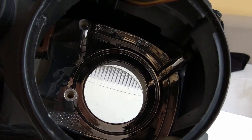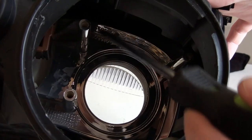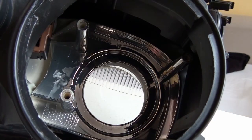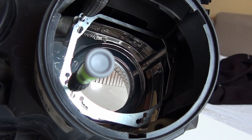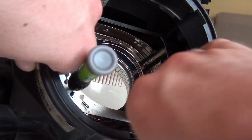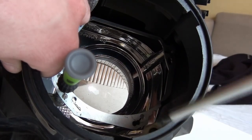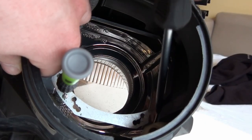Okay, so here's the view of the inside of the headlight. The original projector was already removed from here. Here you can see the three standoffs. So here's the first one, second one, and the third one. These are the three mounting holes that we can screw the adapter into. And why did I shave it off, or trim it? So if we put this adapter here, I stick two screwdrivers through the holes to hold the adapter in, and as you can see here, there is this third hole for the screw. And here the problem was that it collided with this here. So that's why I needed to shave it off a bit.